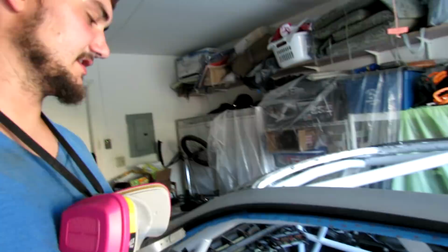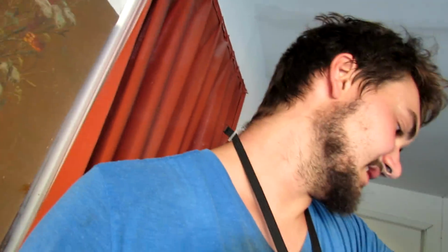So as you can see, everything is white, except the floor and the sound deadening. As you can see, when you paint sound deadening, it turns yellow, or at least if you're painting white. And I didn't get it off today because I didn't feel like buying a torch, because a torch is like $50, and I don't want to pay $50 for something I'm going to use once. So I might try to use a heat gun or something tomorrow, and a chisel. I bought chisels for this, so I just need to get the sound deadening off, finish spraying the floor, and then I can clear coat it tomorrow. That's really it, and then I could proceed to do the roof the next day or something like that.